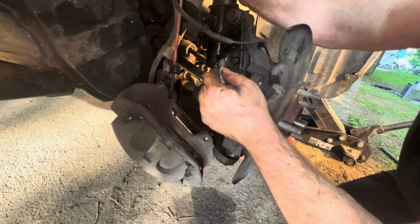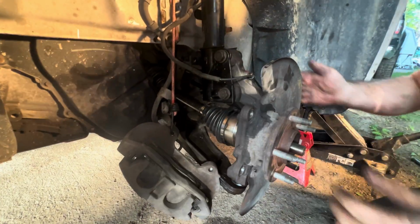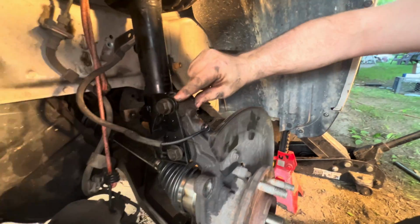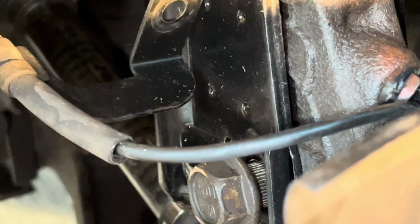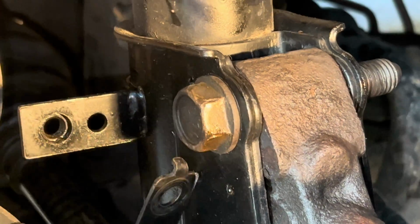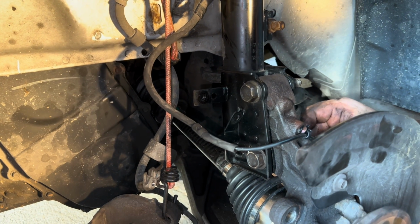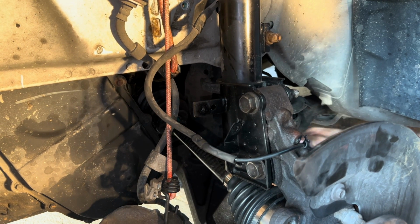So I'm going to move it back farther. See, I'm pushing this back until it lines up. And see, they are lined up now. And what I'm going to do to get these grip threads, this is what I call them, the grip threads on these bolts, to get them in there, I'm just going to tap on the bolts, and then it's in there. And then I'm going to, by hand, start those 21 millimeter nuts onto these bolts.